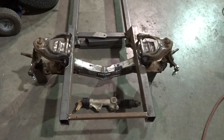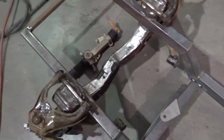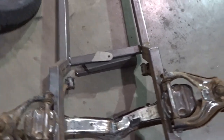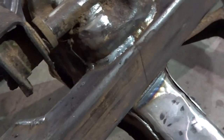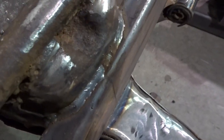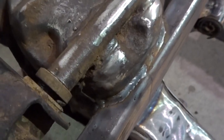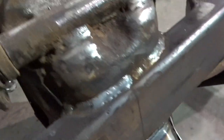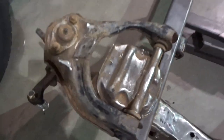Jumping forward a few steps — we got the crossmember in the chassis. What I ended up having to do is knock out all the other crossmembers, notch out the frame rail, separate the frame rail around the front crossmember, then put all the crossmembers back in. The frame rail is notched into the chassis to make the front crossmember as narrow as possible. I also took an inch out of the crossmember, so the chassis at that point is only 1x3, which for this project is more than enough. It's welded on the bottom, welded all the way around inside the spring pocket. I stuck the control arms on just to see how everything fits.